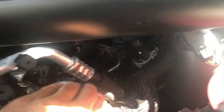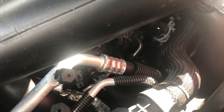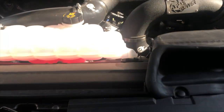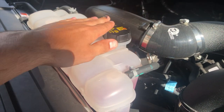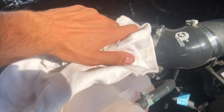The housing on this 3.5 is different than some other 3.5s so you've got to check the date of manufacture. As you can see right there, that is the housing for the thermostat. There's a bolt up top and then on the bottom — both are 8mm — we'll take those out, it'll pop right off. It's going to be super simple.